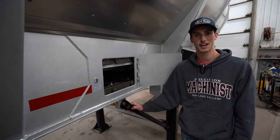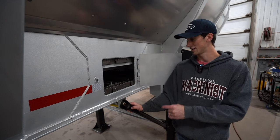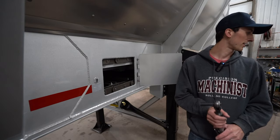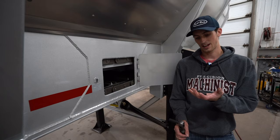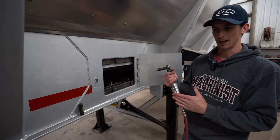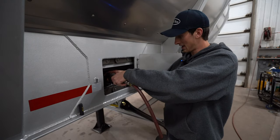Today we're pulling one of the ones that is attached through the belt, so we'll show you how to do that. What you need to do this job is a ratchet and a 9/16ths socket. You also need a half-inch socket if you're pulling your belt bolts. We're using air since we have that luxury in the shop today.